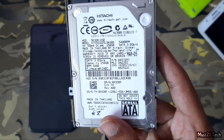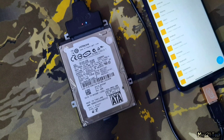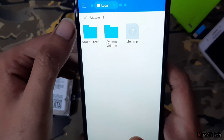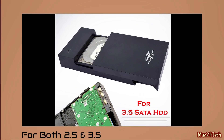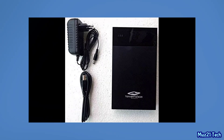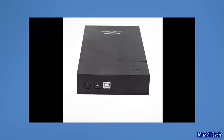It's a smaller hard drive, so my phone is able to provide enough power for it. But a larger hard drive will probably need more power than the device can provide over USB. So there is another option: buy this gadget — link given in the description — and plug it into the OTG via a SATA to USB adapter with external power.